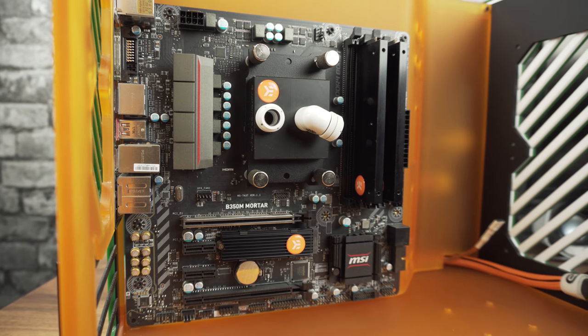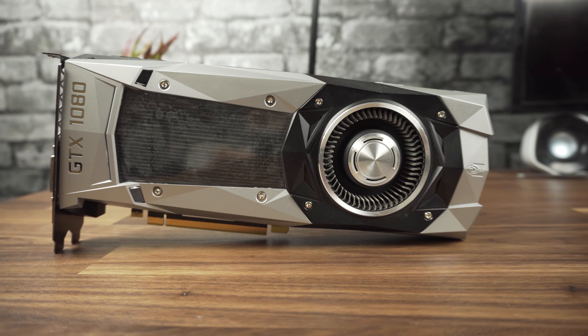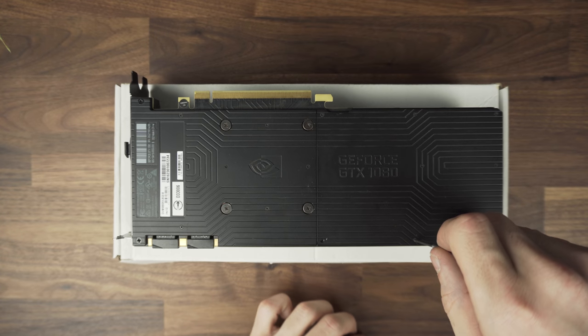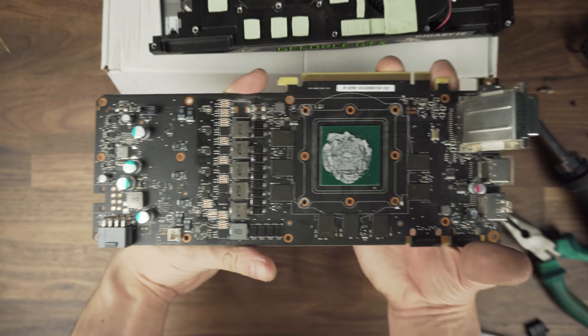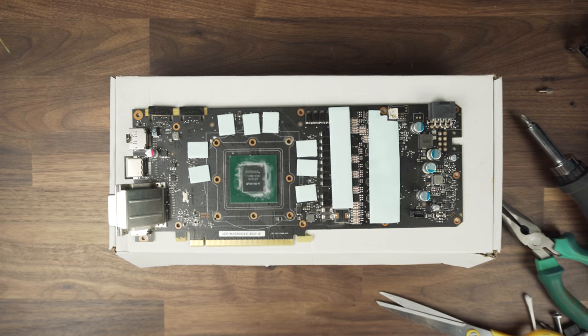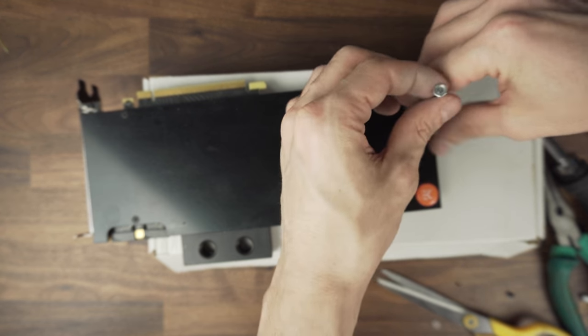Our SSD is mounted. The PC is starting to take shape — let's get to the GPU. I used the GTX 1080; it was the most reasonable price at the time of filming. By far the most nerve-wracking part is mounting the water block onto it, but with patience and a good screwdriver it's a breeze. Be careful when removing screws not to damage any transistors. The backplate and cooler should come out easily. Clean the old thermal paste, attach the thermal pads on the memory, VRMs, and the rest of the parts, then place a good amount of thermal paste on the GPU, add the water block, screw it in place, and it's done.